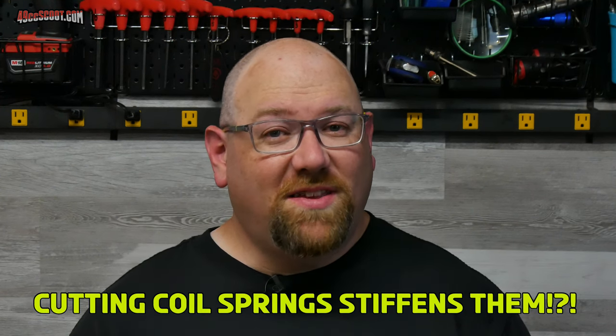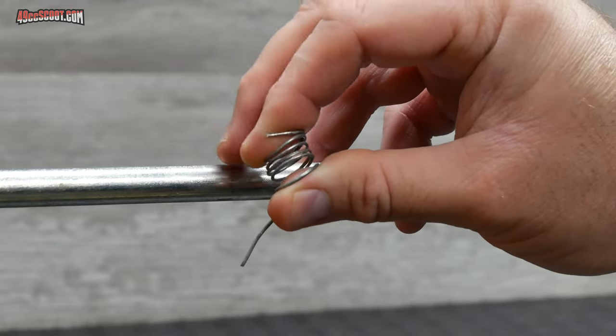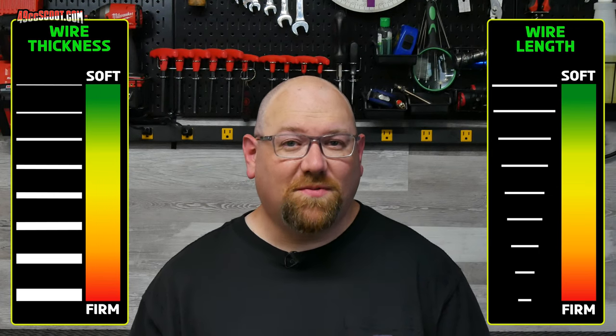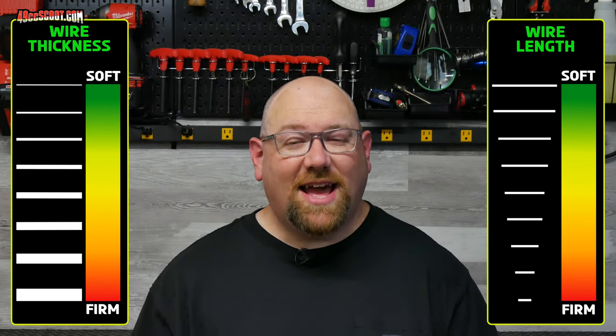I went back to working on the forks while the paint was drying. I'm heavy and most scooter suspensions are a little bit soft for me. I used thicker fork oil and added spacers long ago, and that helped a little bit, but I wanted to see if I could stiffen the front even more with another cheap modification. Cutting coil springs to shorten them will make them more stiff. This sounds counterintuitive, but it does work. I'll put links in the description that explain it more technically and provide calculations, but basically a spring is made of wire — the thickness and the length of the wire used and the pitch of the coils will all affect the spring stiffness. Thicker wire and/or a shorter length of wire will increase the rate or stiffness of a spring. When you cut a coil spring, you're reducing the length of the wire used to make it and that increases the spring rate.